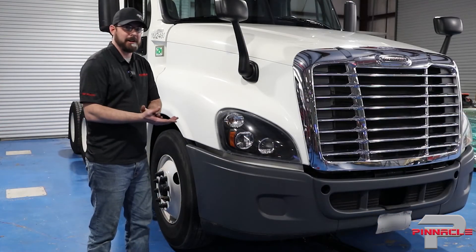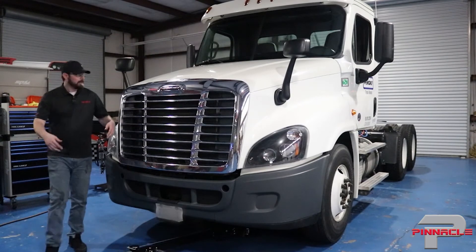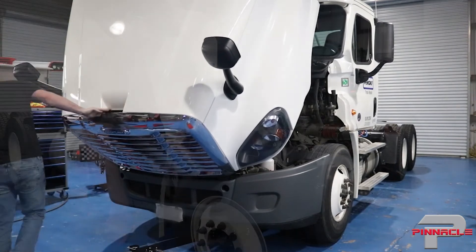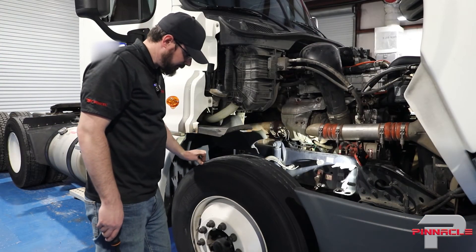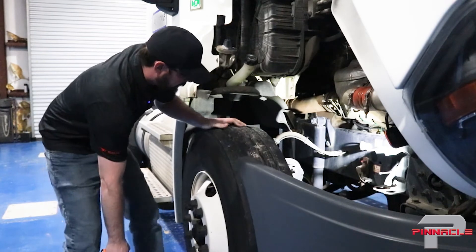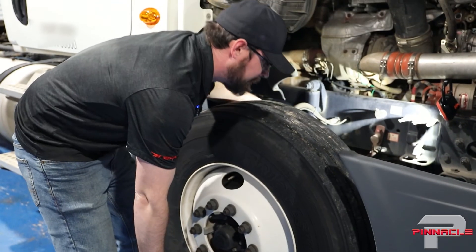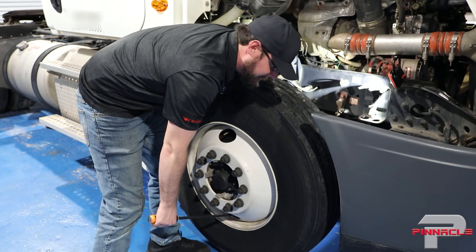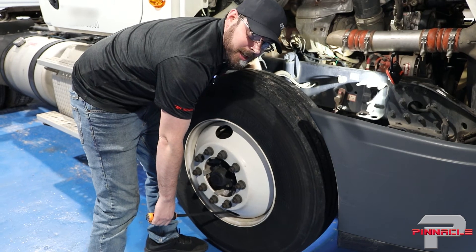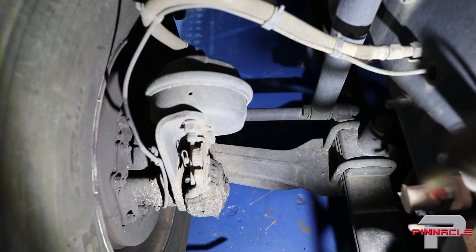With the truck lifted up in front, I open the hood — I waited until after lifting because an open hood gets in the way. I rotate the tire so the valve stem is at the top, then stick my pry bar in the opposite hole and pry hard back and forth. If I feel movement, I reach around and put my hand on the brake hub: if the tire moves but the hub doesn't, that's a bad wheel bearing; if the hub moves as well, that means a worn-out kingpin needing replacement. This one feels just fine.